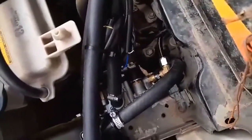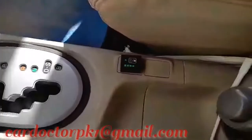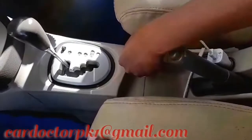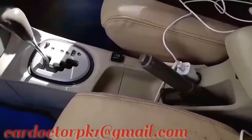Let's now test. Let me switch to LPG and we see whether it is going to clip. It has clipped. Now it has stabilized. Have a look at our LPG switch — it has already stabilized. When this light is not blinking, it tells you this car is now running on LPG. It takes like three to four seconds and then it switches to LPG. This one is fine.